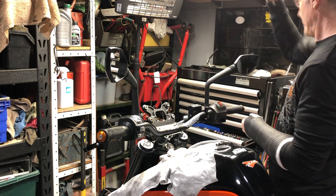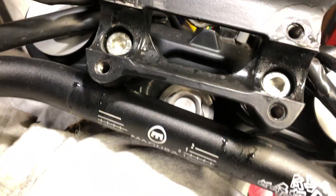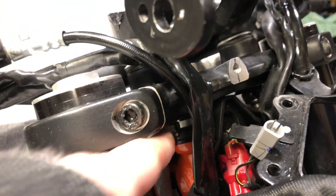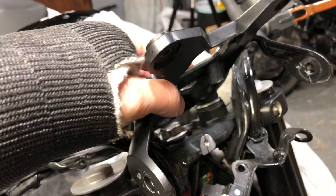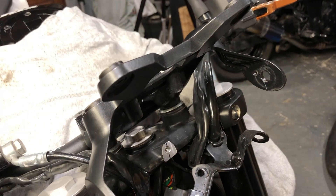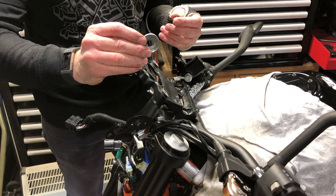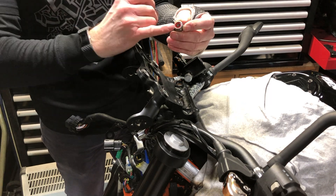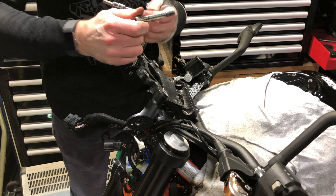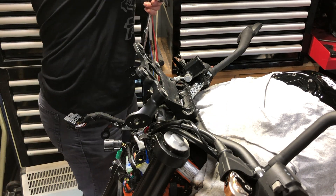The clamp is off and now the handlebars are free. With the handlebars out of the way you can see the tops of the bolts and just in there you can see the nut. I'm going to get a spanner in there and take those nuts off both sides, then I can pull the clamp off and see if it's actually square or maybe one of these bolts is bent. So let's get the clamp off. You've got a bottom cap which sits under the bushing — that feels pretty tight, like it's under tension.